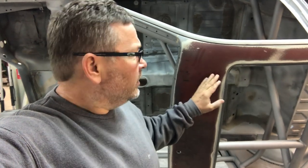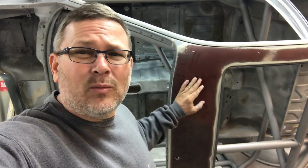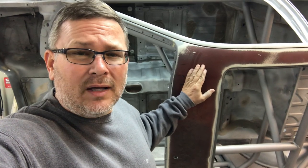We're going to be stripping the outside panels of this 944 with sandpaper, as opposed to having it sandblasted like they did the interior. The sandblaster will create heat and it'll warp this metal up really bad. If we do it with sandpaper and take our time and don't get the metal hot, it alleviates any warpage.